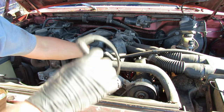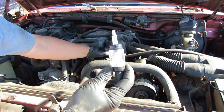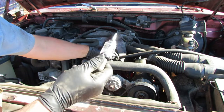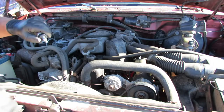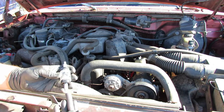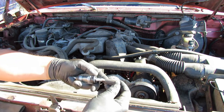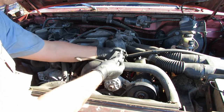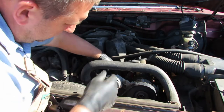We're going to pull this off and plug this inline spark tester in. All of these tools I'll have links in the description so you can see what I'm using. This is kind of a neat tool because it can either plug on for a 90-degree or straight inline connection. This truck needs the inline, so that can just plug onto there. You take and plug this into where the spark plug would go, and then plug this into the spark plug.